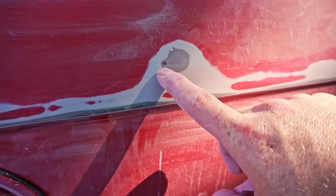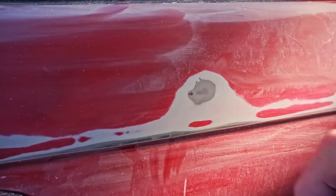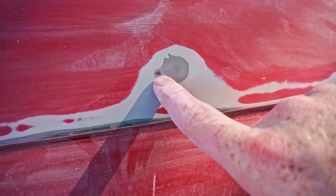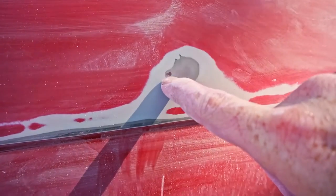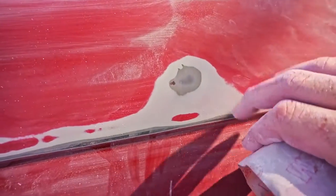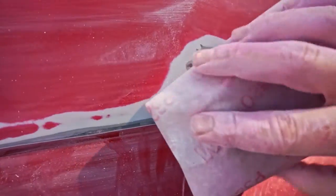You can still see a chip here — you have the clear coat, then the color coat. You can see the layers: clear coat on top, then the color coat, into the primer, and there's a base sealer that's kind of greenish. Right in the middle you can see I got down to the metal. What I did was sand all the way around that chip, down through the clear coat, color coat, primer, and sealer all the way to the base metal, trying to get rid of the hard edges of the chip.